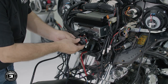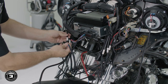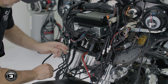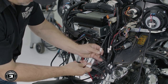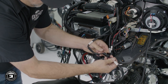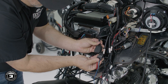Once you're done with that, attach the 35-pin rear radio harness into the back of the source unit and connect the Molex end into the amplifier's rear input. Finally, connect the rear bag lid harness to the Y adapter on the amplifier's rear output connector. Once you're done with that, plug the power connector into the amplifier, noting the blue turn-on wire is not used in this configuration.